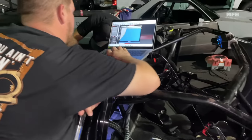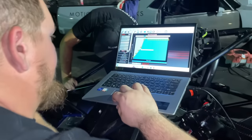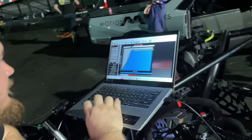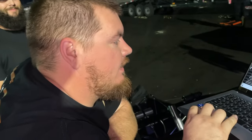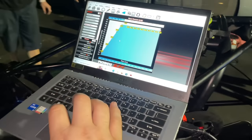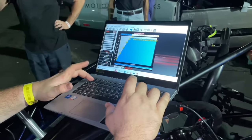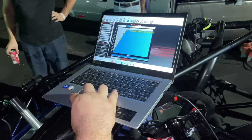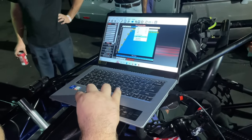All right, another call to Rob at Advanced Clutches, and he is telling us to go spicy. He's telling us to put weight on the clutch. He's telling us to launch 300 RPM higher. We're now up to 5,000 RPM launch, and I'm going to bring all the boost in by 1 second. And we're putting the boost to it. So it should make about 26, 27 pounds of boost, I would guess, on this setup. And if it does launch like we're hoping, it's going to be intense.